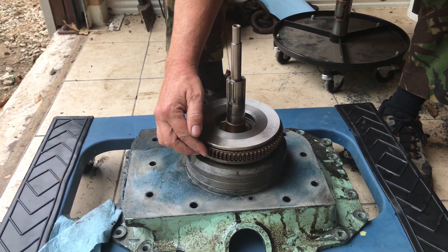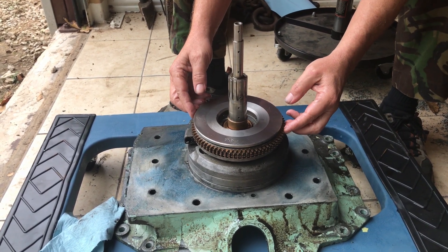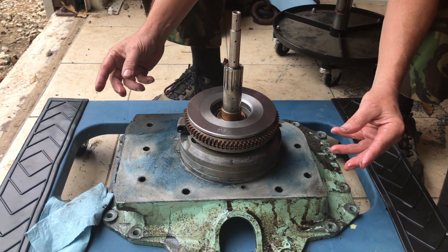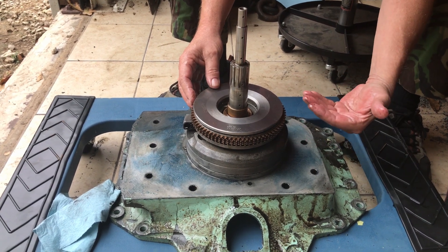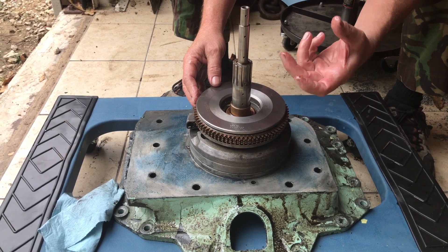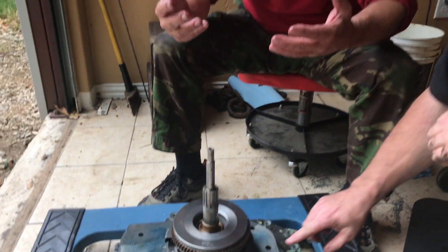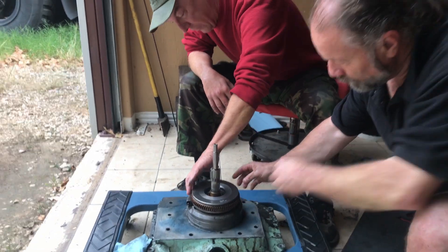There goes number four. Right here you can go no further. If you had a band or a clutch plate that was broken and split in two, this piece would fall out. This has four clutch plates. The only way to access them is to go to the other side, remove the oil pan or oil pump. There's a special nut on the other side that's keyed and also reverse-threaded, then you can spread the whole thing and get to the gears.